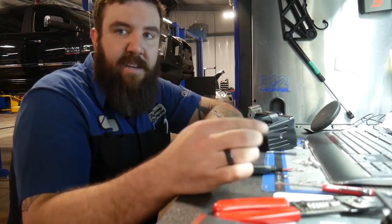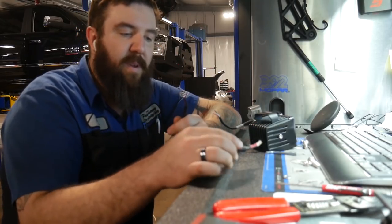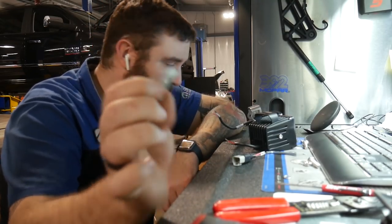As you can see up in the bumper there are nice slots already in there for the fog lights to be mounted. The last thing we want to utilize is the factory harness for the fog light system so we can just plug it right in, and if we need to unplug stuff in the future that's where we've got a test point. The factory ones just kind of hanging out here will be tucked up nice and neat in the bumper with the factory harness. One of the lights came with a nice set of pigtails and we're going to be wiring our female connection in.